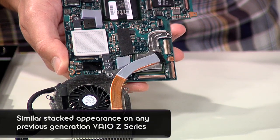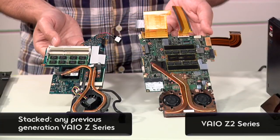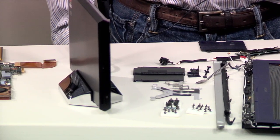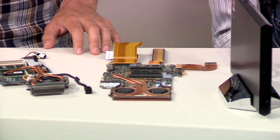So we've taken it apart here. Let's really take a look inside. We've taken two laptops apart today — one of the previous generation Z and the new generation Z — so we can really show you what's changed. We've got the old one right here. The first thing you can see is the different layout: the parts are stacked in the older model, and then they're flat in the new model. You can see the difference especially when you look at the casings of the old and new. Tell us about some of the engineering that went into making the new layout and why you went with flat instead of stacked.